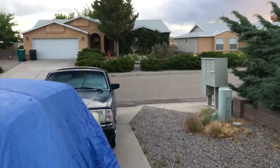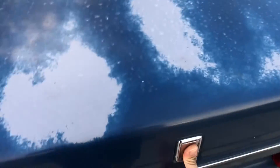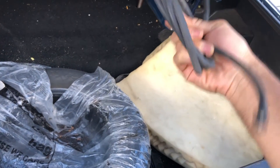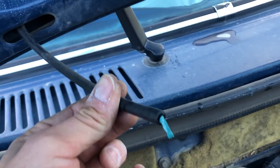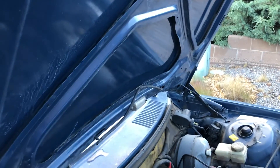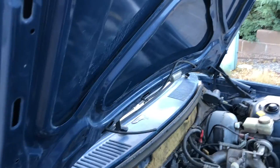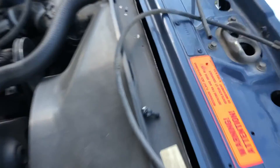It feels like a weird spot to end the video without the wipers actually working, so I quickly put in parts I grabbed from the junkyard from a 240 — replacement hoses and a sprayer nozzle. It looks like the last six inches of line is just a ribbon of blue residue from the old stuff. I pulled that one out and sprayed it thoroughly inside and out. You can use a Q-tip, toothpick, or something to clean out the old residue. That side is sprayed out and cleaned, and the other one gets that whole section replaced.